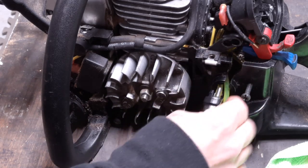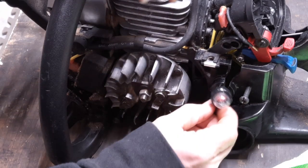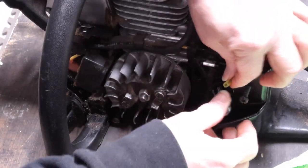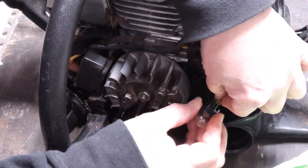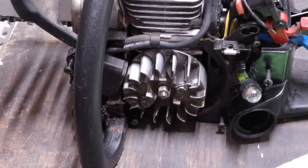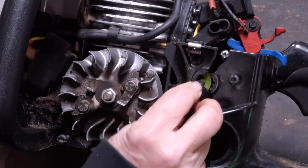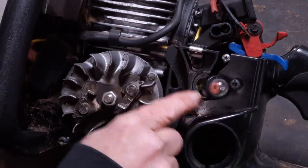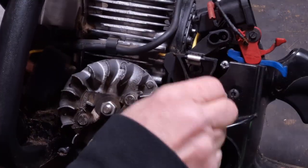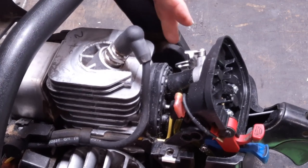And then you got this little outlet right here we can work with, this little groove. We got our fuel line routed. Let's see if we can finesse the barb on there — it's been finessed. You'll look at this little base for this primer bulb. You got tabs on the back — make sure you line them up with them two little slots. We'll seat them down in there.